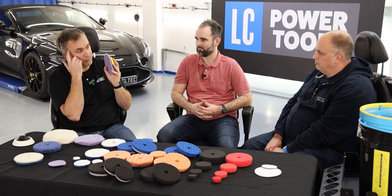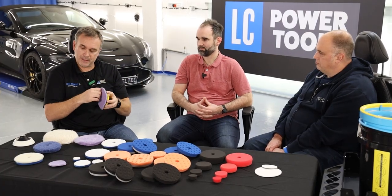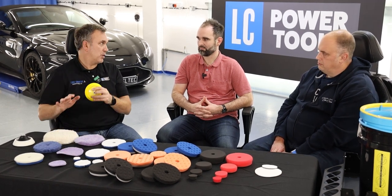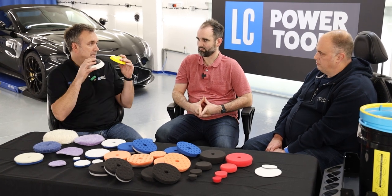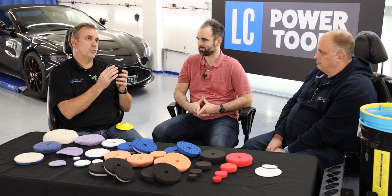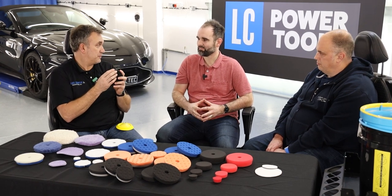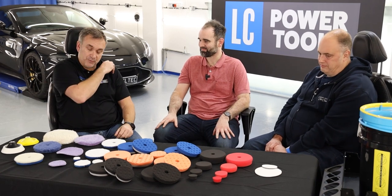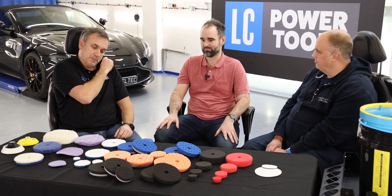So ultimately, I can prove this, I can alter the level of cut with any rotary pad, depending on how soft or firm the backing plate is. And I've got a very old backing plate that's gone so soft it's almost nearly disintegrated. It's been used for years because I'm always pushing. I've kept that because that's even softer. Because I can actually change the contact patch by the backing plate, but this is very geeky, very specialist. So people prefer soft backing plates or firm backing plates.